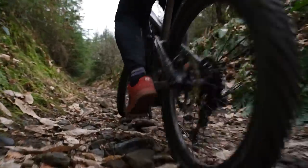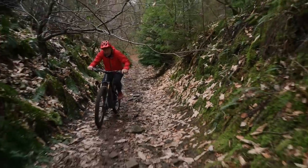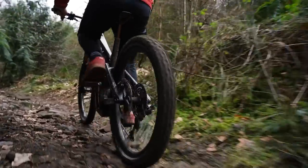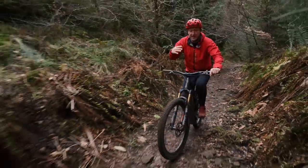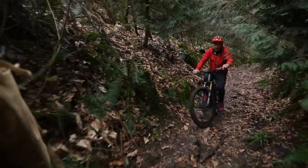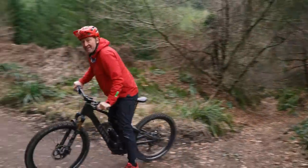10 PSI — let's go looking for trouble and slidiness. The trouble with climbing on an e-bike is there's a tendency to keep a high tempo because of the fear of spinning out and breaking traction. The great thing with low tire pressure is it allows you to pick your way up a climb. You can have a lower heart rate, work your way up, pick your lines — it's simply a better way to tackle a climb. This is where the strong sidewall of the tire is important. Even though I'm on 10 PSI and 90 kilos, I'm not bottoming out on the rim. I can slow down, give a breather, then tackle the trickier sections. Slippery rock here — no problem. So much grip!